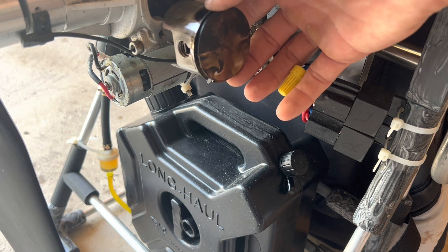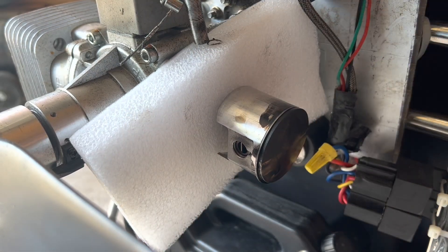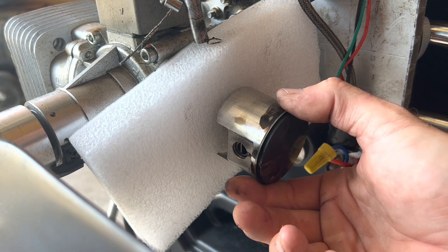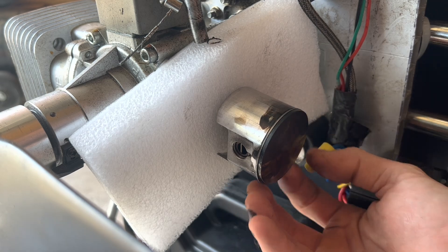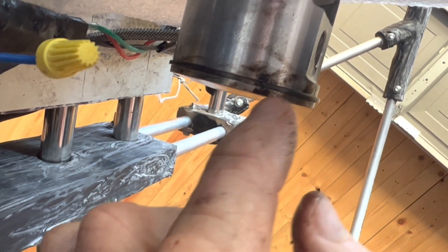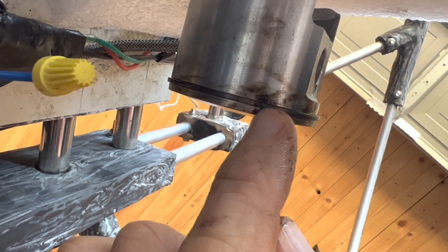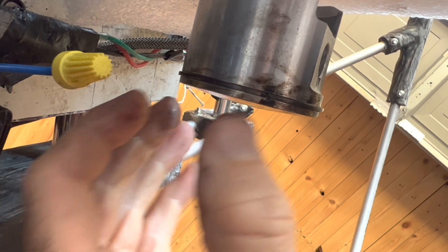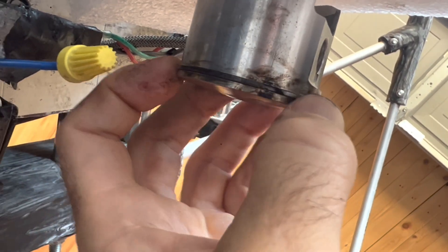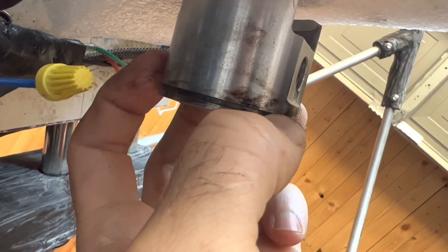I don't think I'll have to replace the piston anytime soon. I'm going to place that on there, and then we've got to find that center notch — the anti-rotation pin. I believe on this one it's on the back side. There's a little pin in there — an anti-rotation pin — so I'm going to wedge one part of that ring up against that, and I've got this thing greased up.